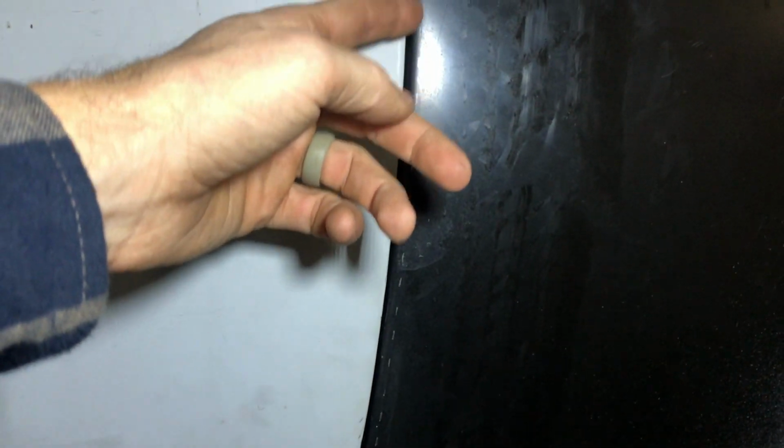it was done. The best way to do this, since this is in a press bend, is I'll probably end up drilling out the spot welds, and first I'm going to cut it so everything relaxes, and then I'll cut both of them. I'm gonna drill out the spot weld, because when I beat it back and go to weld it, this flange out here that's gonna get spot welded could move. If I keep that tight to where it's at and I beat it back and I weld it, I'm liable to get damage in here.